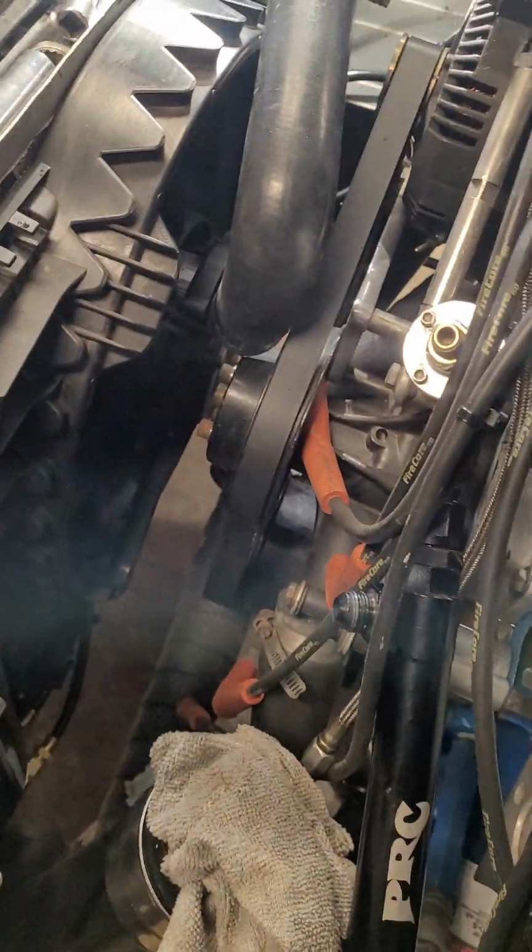So now, and this isn't me making this up, okay? This is directly out of Ford Racing's catalog. This is how they want you to set them up. I don't have the exact numbers in my mind, but each shim is a different thickness, and you can stack them or whatever you need to do. If for some reason when you do this procedure you don't need a shim, there's definitely something with your pushrod length that is clearly off. So just keep that in mind. And you can find the Ford Racing directions right online for pedestal mount rockers too. It's pretty easy to find.